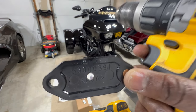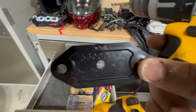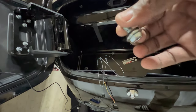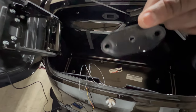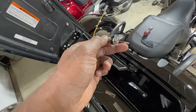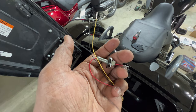I was able to make that one-quarter-inch hole and now the plate is ready to go back on. Back over here at the bike, the next thing I need to do is get the hollow bolt back and run the wires through it so I can secure the rack back in place. I'll run the wires through here, then through the plate, and then I'll put this back. I'll need my flathead screwdriver to remove the seat, and then I'll run each wire individually through the bolt.